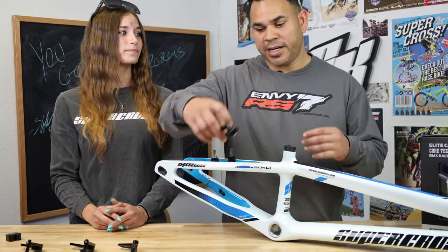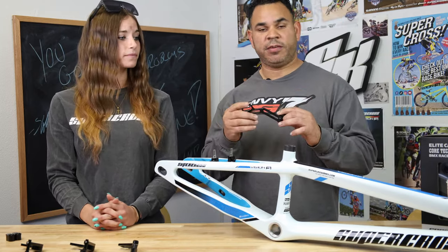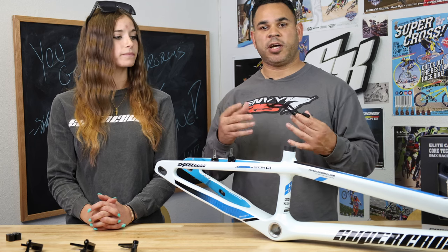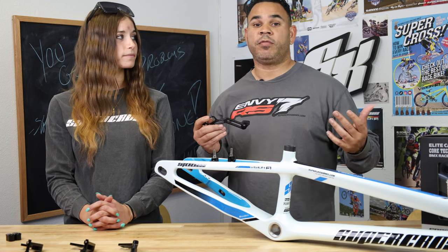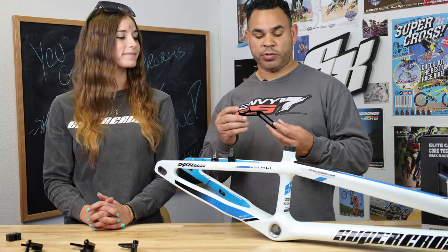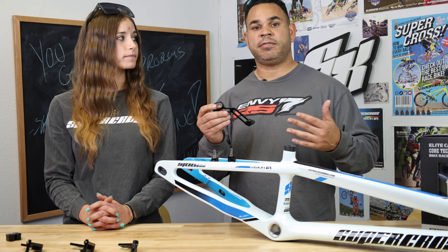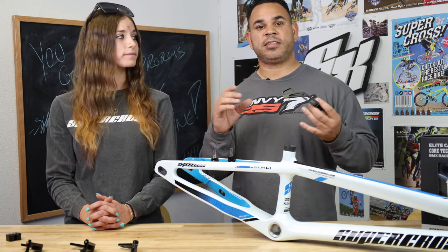This is the newest one to hit the web store right now. When we dropped the Vision F1, we kind of designed it around everybody running more of a traditional setup — maybe 43-16, 44-16. But as things have gotten more technical, people are looking for a little bit more gearing advantages. One of our own riders, KJ Romero, our vet pro — up for the title usually, always racing well — he is running what's known as the larger gear set. He typically runs like a 47-17, maybe even 48-17. So his entire gear set is a little bit bigger.